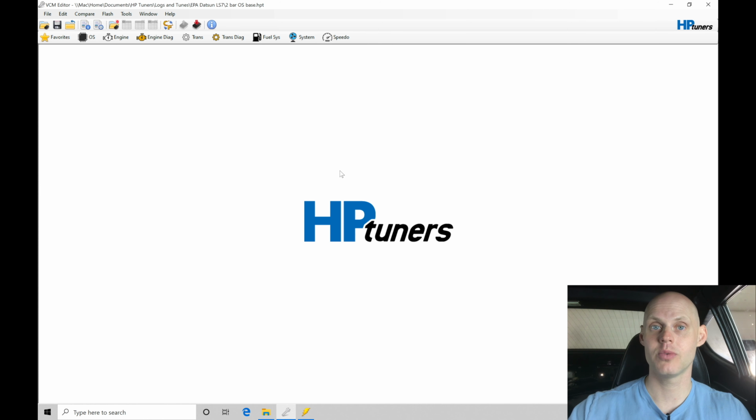This video, we're going to be focusing on making sure the injector data is going to be accurate. We're starting with injector data that may not necessarily be the correct data. So we're going to learn how to modify that data in order to make sure that our idle airflow is being reported right from our dynamic airflow channel, and then also making sure that the idle control is going to be sorted out and we're going to have a relatively stabilized idle.